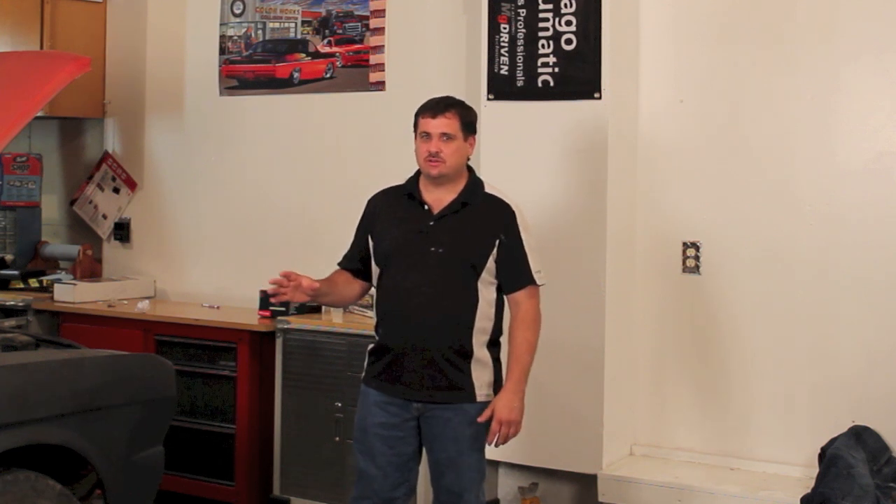What is my preference? If it's a bigger area — say bigger than a silver dollar in size — I'm going to go ahead and mix up some epoxy and use that. If it's smaller than that, I'm just going to get the spray can self-etch primer and hit it with that before I seal or apply primer surfacer. Rather than get too concerned about which one to use, they will both work fine. The thing to remember is: if you have bare steel, don't just put primer surfacer on it — put one of those two. There is also a third option, and that's DTM — direct to metal primer.